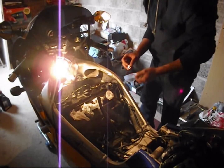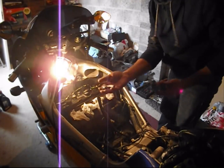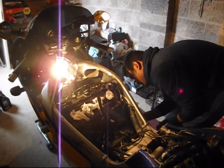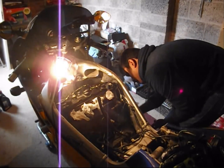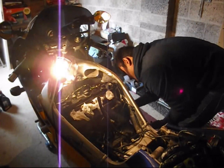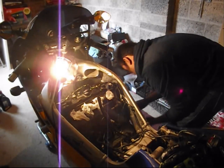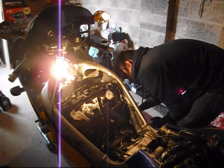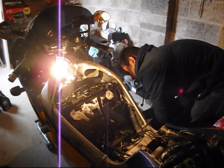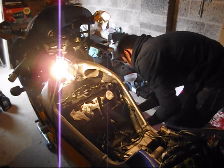So now we'll put the timing and the crankshaft caps back on. For that we need good old 10mm and 8mm hex bits. Nothing tricky there, so I won't cover that. I'll just put them in, they don't need to be torqued. Nothing safety critical there. Just nip it up with the ratchet. So, you feel it. Yeah, done.